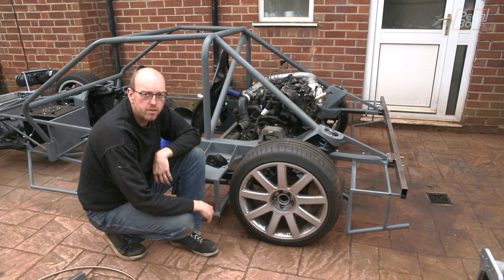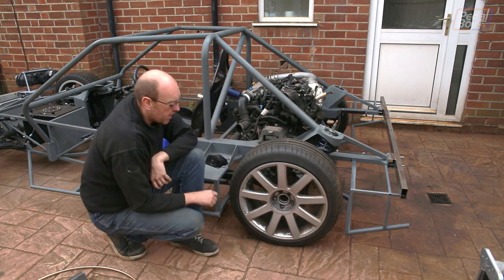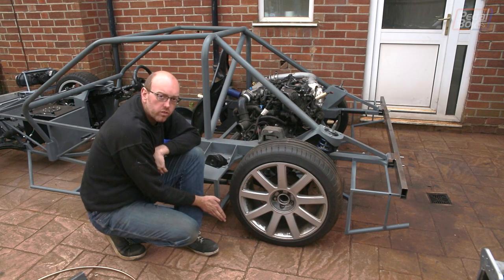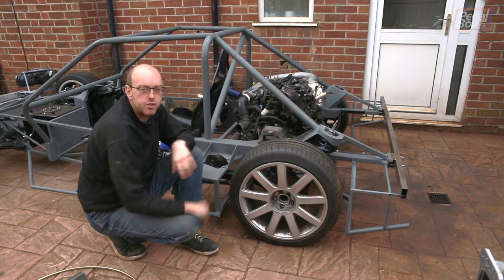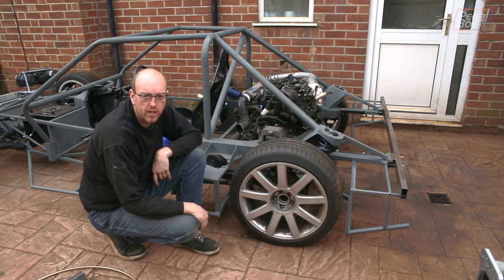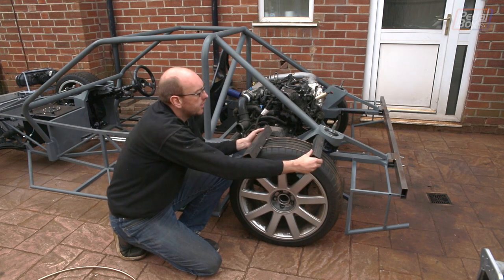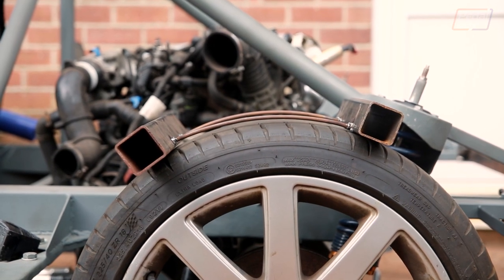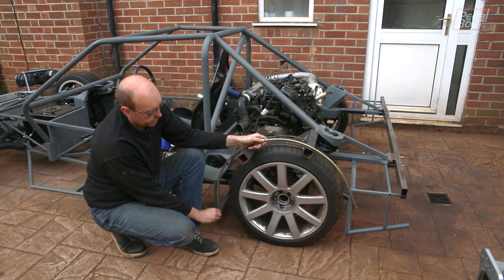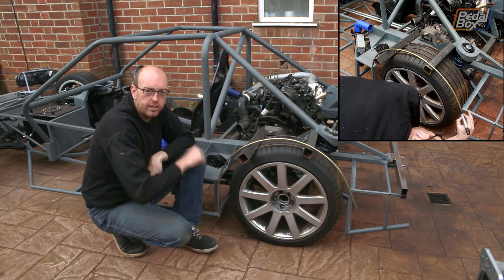Now we've got the wheel back on the car on the ground, we can start working on this outside lip of the wheel arch. It's going to come all the way from down here on the floor right the way around and join onto this point, and the reason we're doing that is to mount all of our bodywork structure. This isn't necessarily going to be the inside edge of the wheel arch — we can come a bit further down if we want. It gives us a good couple of inches of wheel travel and a nice platform to build whatever bodywork we want. We're going to start with this template piece I made — just some 2-inch box section with rods welded up between and bent in the ring roller to fit nicely around. It's some 10mm tube which bends quite nicely and will give us a nice 2-inch radius all the way around. It makes it replicable over to the other side when we need to do exactly the same thing again.